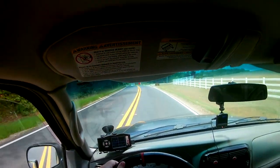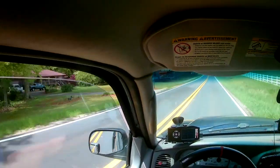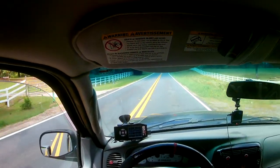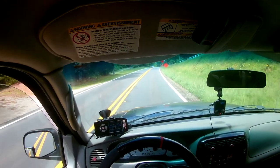That was incorrect. They are actually hooked up to a sensor, so you will need to do some sort of fix, whatever you may choose to do for that. We wound up using an O2 extension to fix that issue with the codes and all that stuff. So now it's completely emissions compliant, no check engine lights or anything like that.